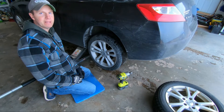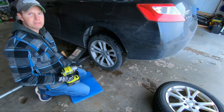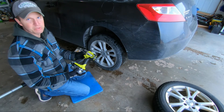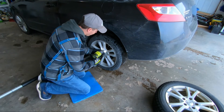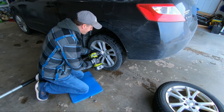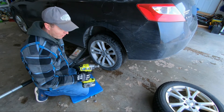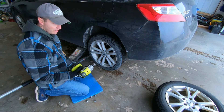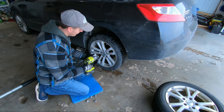Now that you have the proper amount of balancing beads inside your snow tires, it's time to remove your summer tires. I'm using this Ryobi P262 impact wrench — it works really nice for removing tires. It takes a lot of time out of all the work here. I do have a video testing out this impact wrench as well; I'll leave that in the description if you want to check it out.